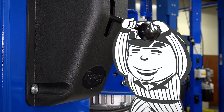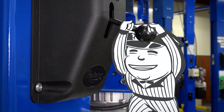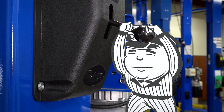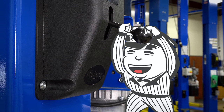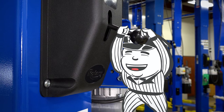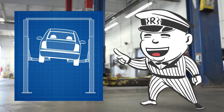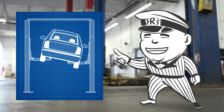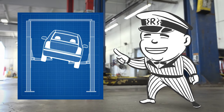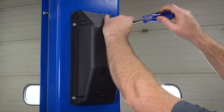The lock release on a two-post lift is designed to disengage the locks to safely lower it, but over time the cable connecting these locks may require adjustment. If one side of your lift won't lower, the cable may not have enough tension on it for the latch release to work properly.